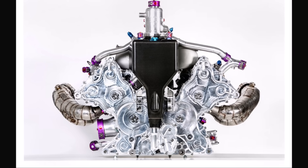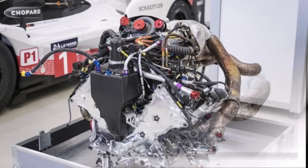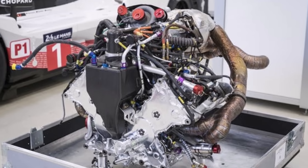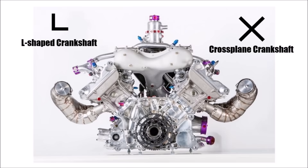There are two possibilities for a crankshaft design on a V4 engine. You can either have a crossplane or an L-shaped crankshaft. For each one of them, you can have a number of different firing orders. My initial thinking was that Porsche surely started off with a crossplane crank and just changed to another crossplane with a different firing order to cure their vibration problems, because an L-shaped crankshaft would definitely create vibration problems and they would not have chosen that.